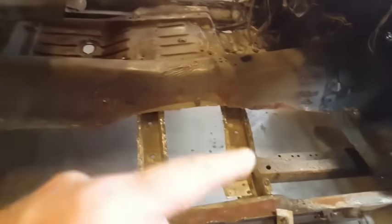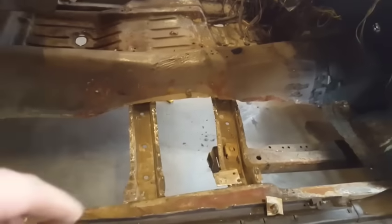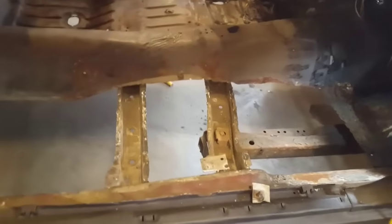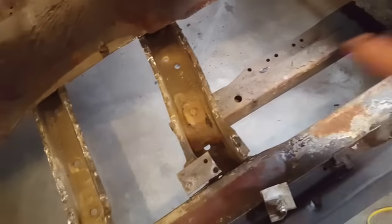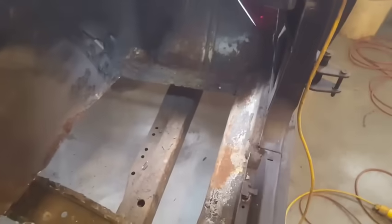It's a bit tricky. If you had a full aftermarket floor pan, these braces would already be on it after putting them in. But these, what I call patch panels, which are just simple little rust repair panels, they usually have their issues, and this is one of the issues with them. GM always managed to lap things in between that, so I can't do nothing about that. I'm not taking them braces out because that involves all the front suspension and everything, so we're not getting into that. So now I'm going to go back.